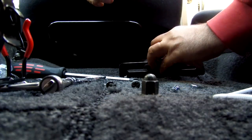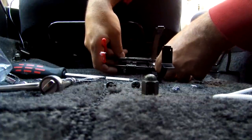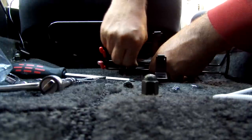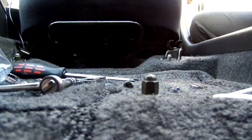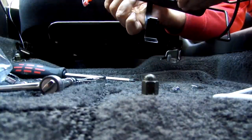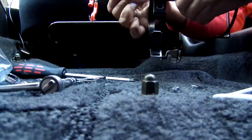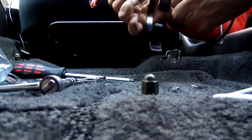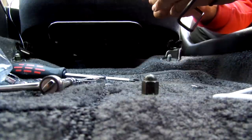Mount the bracket on there just lightly and get an understanding of where it has to mount on the extinguisher, so it's butted up against the floor here. Then what you do is push the bolts through the extinguisher bracket and then the mount. Sometimes the paint can hinder it from going through a little bit because there might be a couple of coats of thick paint on there, but that should be fine — just push it through or screw it in.